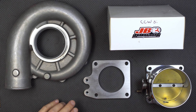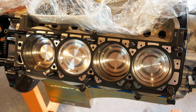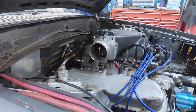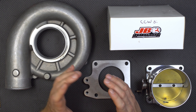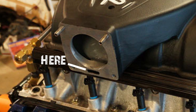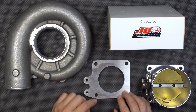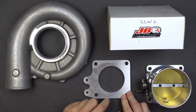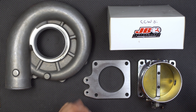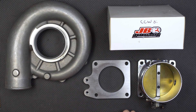There's a lot we can do next. One of the issues with this 365 cubic inch V8 is that it's still using a 75mm throttle body. It's not the stock size, but that is the maximum size on the original Trick Flow street intake. You can go bigger, but you start running into the EGR passage at the bottom. I figured I can port it out with an adapter flange — the EGR bump would be right here at the bottom, in line with the shaft, so it wouldn't have much impact on flow overall.